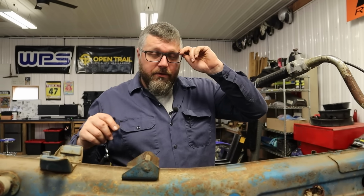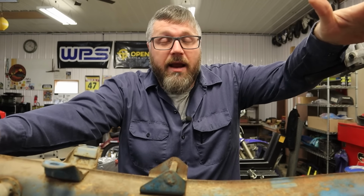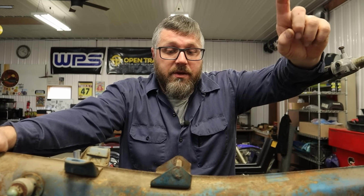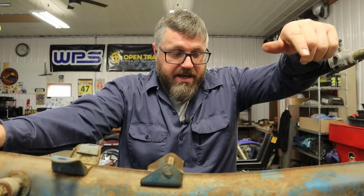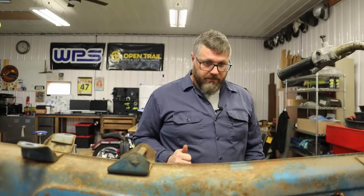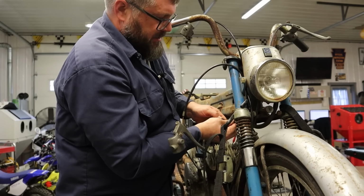Okay, now I know for you in the video that was going to be a 30-second montage, but that was like 3 hours ago and I don't remember where we were. So what do we need to do? Put the carburetors back on, swap out the oil in the oil tank, bleed the pump, hook up some gas, tighten the spark plugs, give it some kicks, fire it up. Back on track.